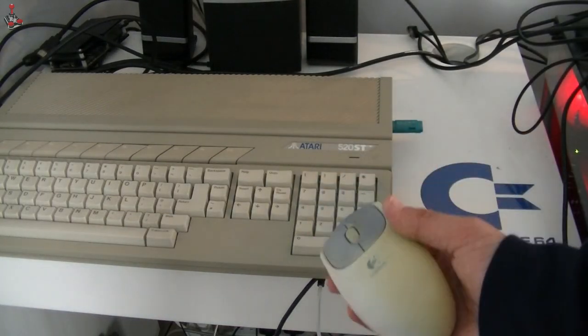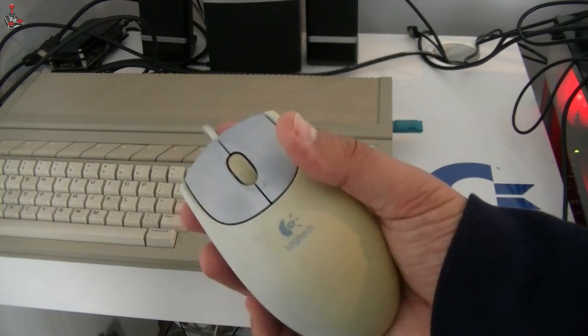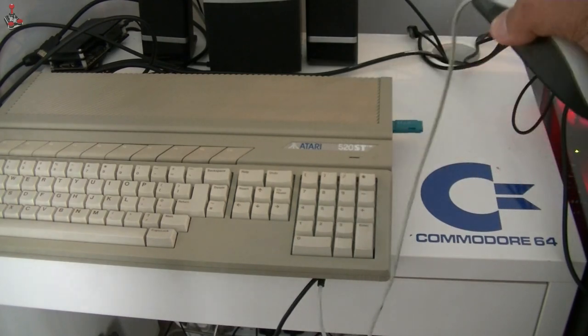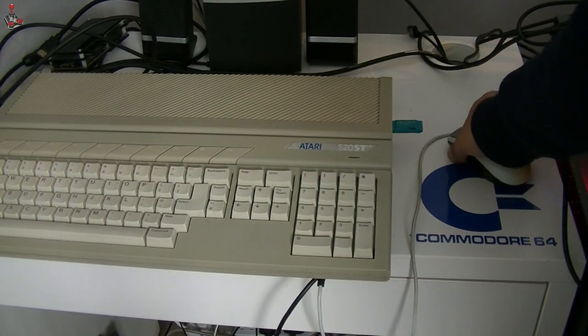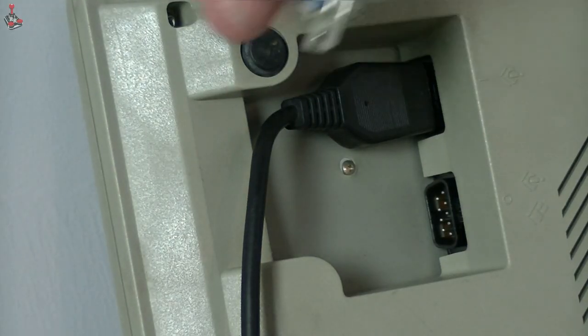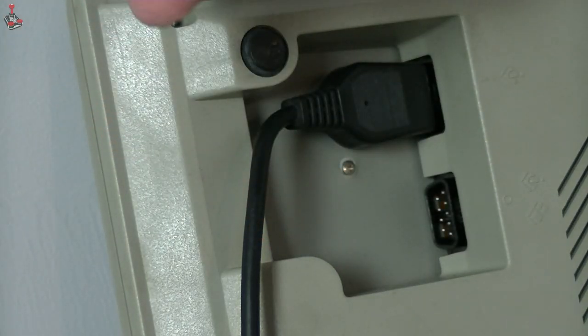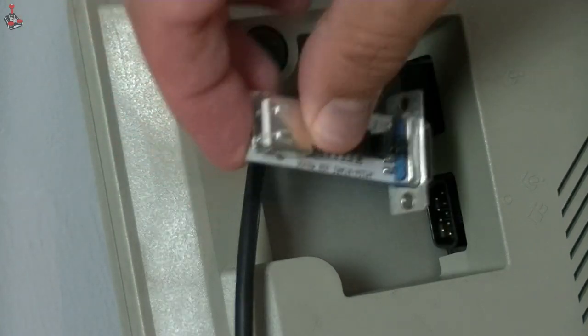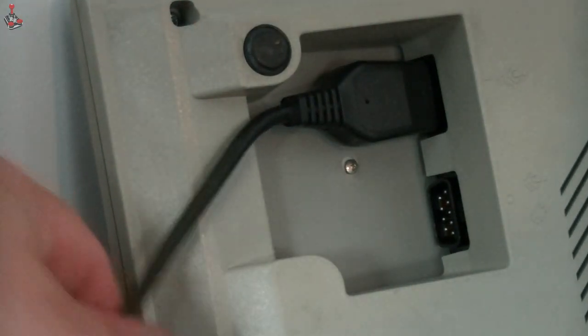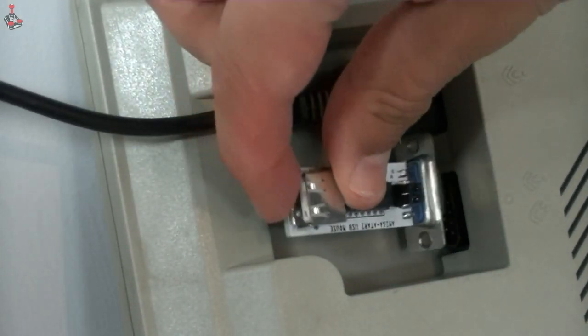It was lucky that I did find this, as every other USB mouse in my possession did not work with the adapter. Newer USB mice very often no longer support the old PS2 mouse protocols which this adapter requires to function. It's looking a little well-loved, shall we say, but at least it's mostly a beige colour, and a close match for both the ST and my Amiga 500.